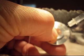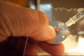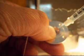I've been doing all this without anybody holding the camera for me, so let's get this done in the first shot. I've got one hole here which is the bottom hole, and the other hole is up here right next to the squish band of this engine. I'm going to inject the water into this bottom hole until the top hole has no more air coming out — until it's all full of water. I started at 0.40, so hopefully this will work.